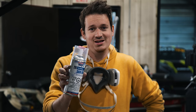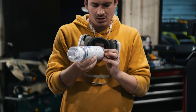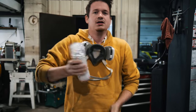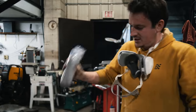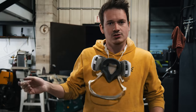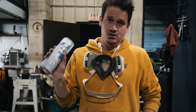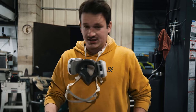This is our 2K clear coat — 2K meaning it's got two parts, kind of like an epoxy. You take the piece off the top, stick it on the bottom, mix it, shake it up. This stuff is super toxic but it should give it a nice protection layer on top of the paint and also make it easier to wipe up dirt. I'm definitely going to have a lot of scuffs on the door bars getting in and out of the car, so you don't want to lay this on too thick on the door bars — and if it runs, well, it's clear.